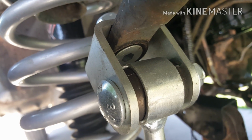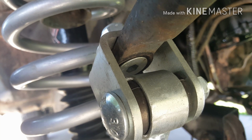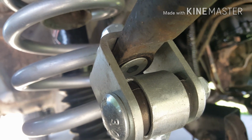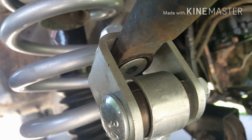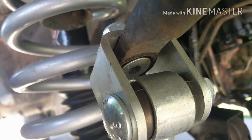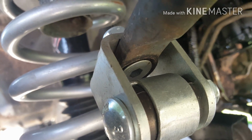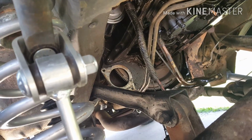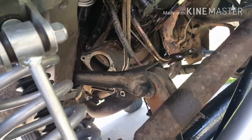They get dirt and stuff on them, and that rubber seal that goes around the oil pan, that holds the oil pan up, it actually will squish in enough so you can get that 1/2 inch socket in there. Seems impossible, but it's easy. It's not that bad. You just got to put a little muscle into it and you'll get them out. This video is where I put a new seal kit in there because it was missing an O-ring, which was lovely.